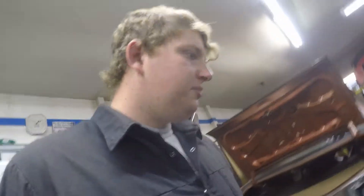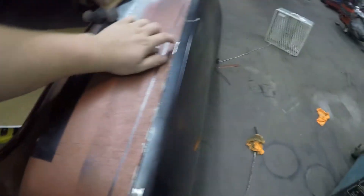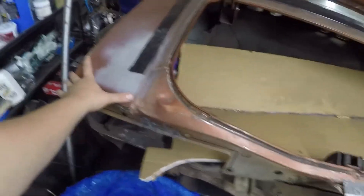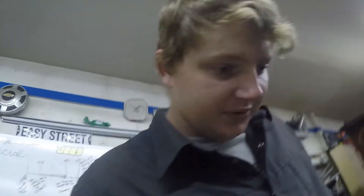Mostly for beginners — this is my first ever quarter panel replacement, so I kind of don't think you should follow me exactly, but overall you get the gist of putting one on. It gets really simple, especially on an old car. Taking measurements every so often until you get it right really helps, and it really helps if you use the other side of the car as a reference — if you have one obviously. If you don't, you can't take measurements from that.